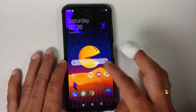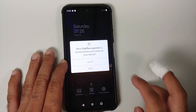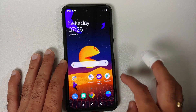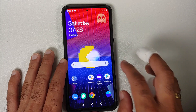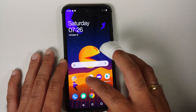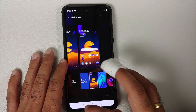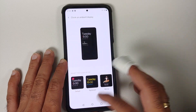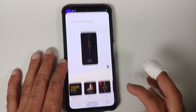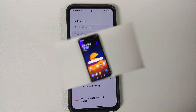What are the prerequisites for this video? You need to have an unlocked bootloader and you need to have TWRP Recovery installed. Videos for how to unlock the bootloader and install TWRP Recovery can be found in the description. Next, make sure your battery is charged at least 50 to 60 percent. Do not do this process if your battery is at 20 or 30 percent. Also, make sure you have a backup of all your pictures, videos, and anything important, because we are going to perform a format data and you are going to lose everything on your device.